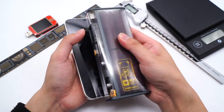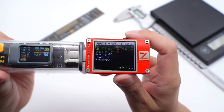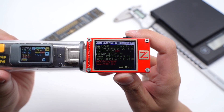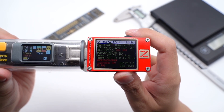Compare it with iPhone 12 Pro Max. Use ChargerLab PowerZ KT002 to test the protocol. The USB-A supports Apple 2.4A, Samsung 5V 2A, DCP protocols, and QC2.0, AFC, FCP, SCP, PE2 fast charging protocols.